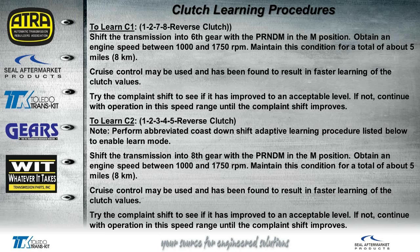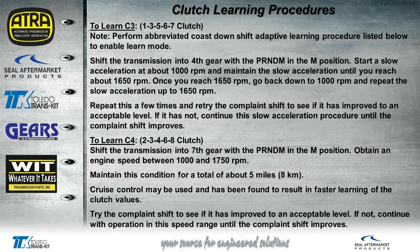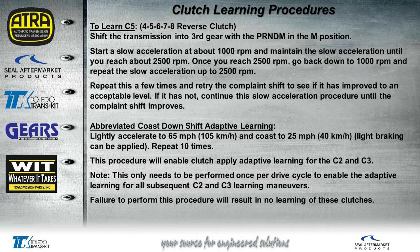You'll see in your handout material on your apply chart, I listed those identification letters and numbers above each of the clutch packs. To learn the C1 clutch — the C1 clutch is actually the 1-2-7-8 reverse clutch — it'll give you the procedures to follow to re-learn that clutch. Then you'll also have the C2, C3, C4. On the C5 re-learn, the bottom paragraph says to repeat a few times and retry to feel any shift complaints. So it doesn't have an actual set amount of times — you may have to do it 10 or 20 times to get that shift fill to feel right.